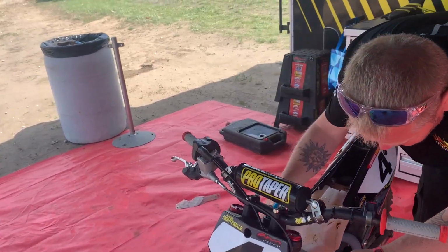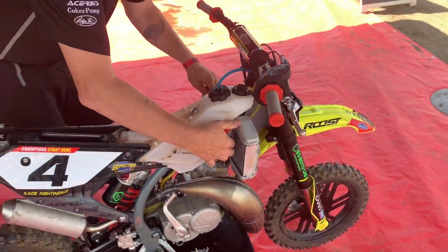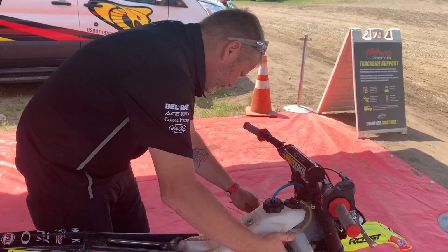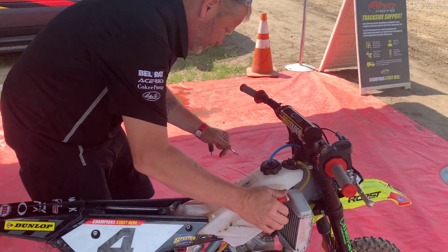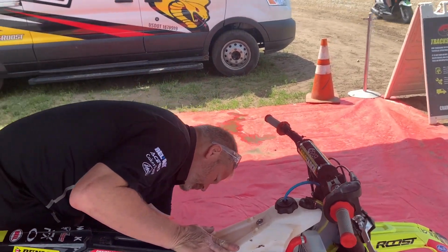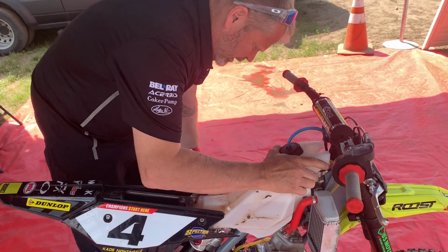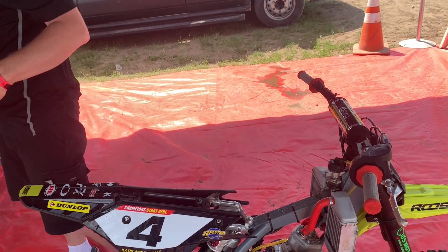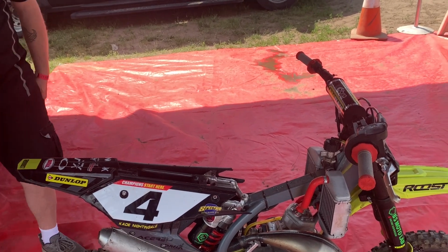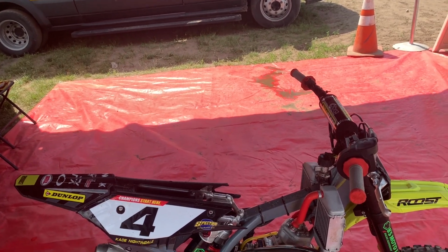Coolant drain, the seat off the bike, the shrouds off it, and now the tank. So a few critical steps in the process here that you'll notice Tyson checking. They're very important steps here. Will be the ring end gap and the squish on the bike when he's all set here. So they're a little further down the process as you get the bike assembled, but this is going to give you guys a chance to see exactly how they're measured, what's measured, and everything.